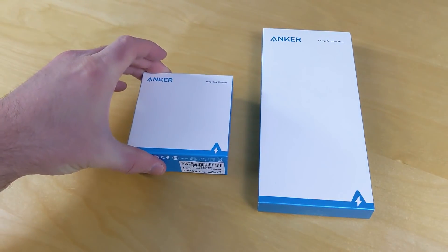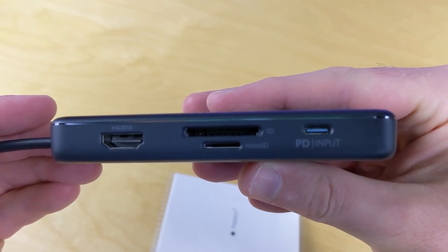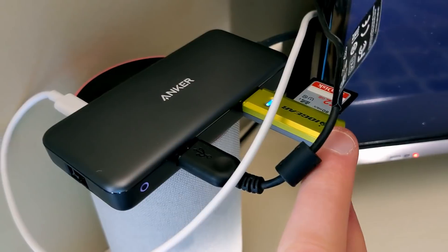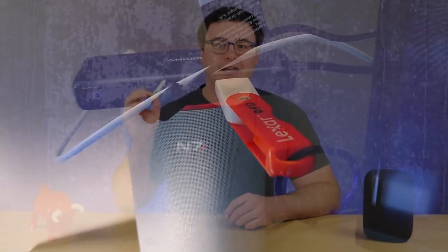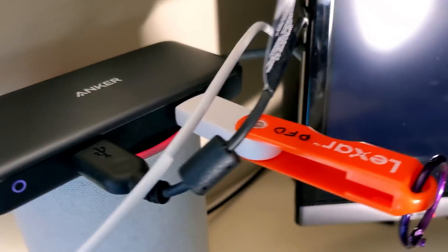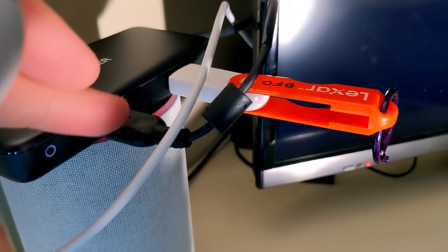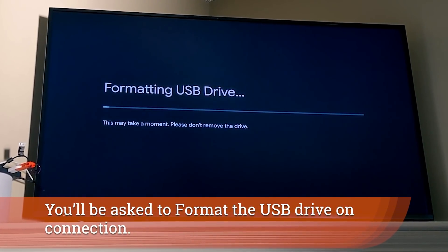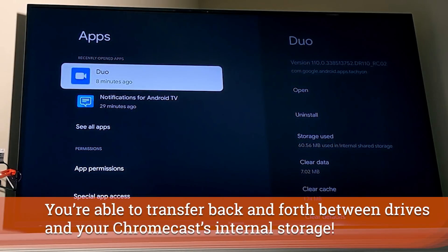There are a couple of methods to install more storage. The SD card or micro SD card holder didn't work for me, so I purchased a dongle from IO Gear which has its own micro SD and SD card interface. Connected into one of the standard USB ports — bang, instantly perfect — and I was using 32 gigabytes. Thumb drives also work connected into those standard USB ports on the hub. You can migrate storage across between the two and plug and unplug as you need different apps.